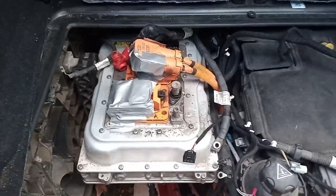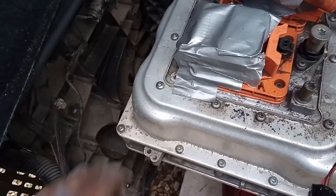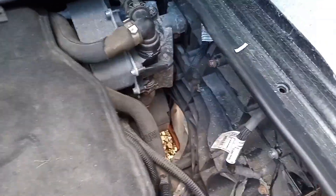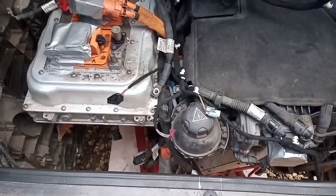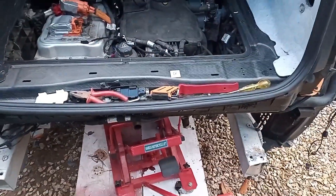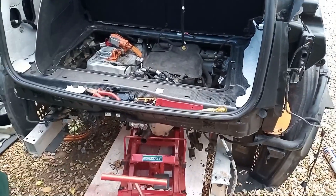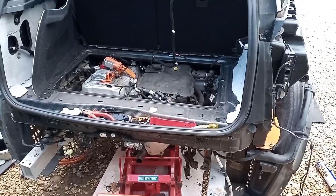It's all jacked up and bolted in. Because of the shape of the car on that side and that side, we can't actually fit the motor past - it's too narrow. If you didn't have the range extender it'd probably be a damn sight easier, but we do. So I think we're going to have to drop it down as low as we can and then maybe get an engine hoist or crane and lift the back of the car up higher to get everything out. But there's still a ton of batteries under the car so we're going to move on and take the battery pack out.